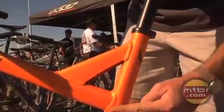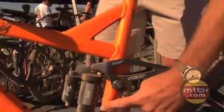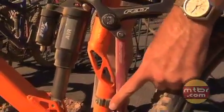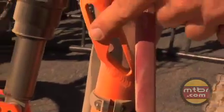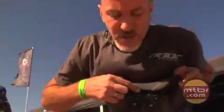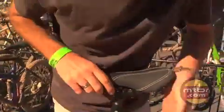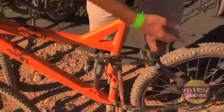Looking at the seat tube area, you notice the difference between the Virtues and Compulsions that we have. The seat tube comes down, it's jutted forward slightly, and it meets up with this special seat tube joint that we designed. We did that so that we can use a standard band style Shimano front derailleur and yet come up and meet the same geometries. If you do a straight line through the seat tube all the way up, it would intersect the seat post at exactly the same place as you would if you had a straight seat tube. But we take that angle and rotate the whole thing forward slightly so that we can have clearance behind the tube for when the tire comes up.